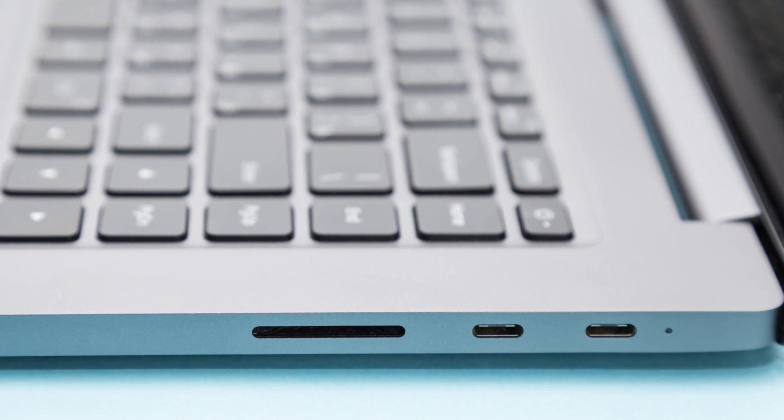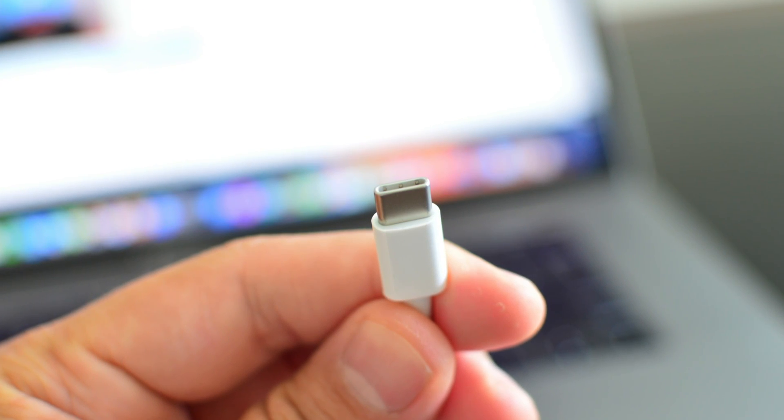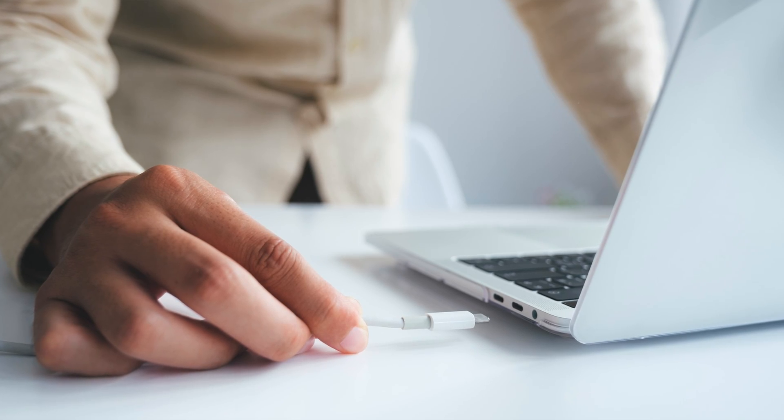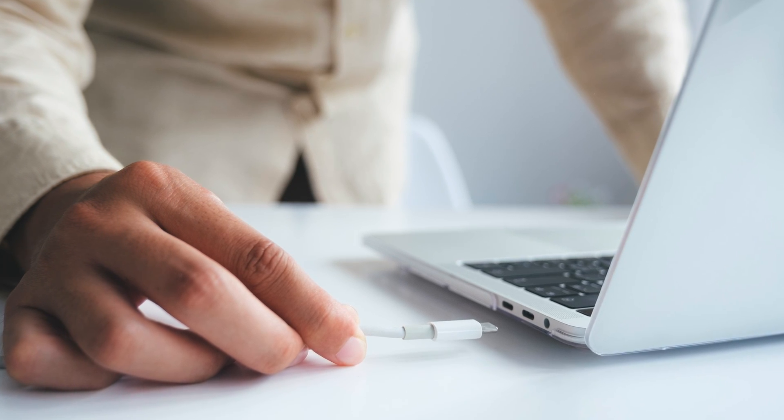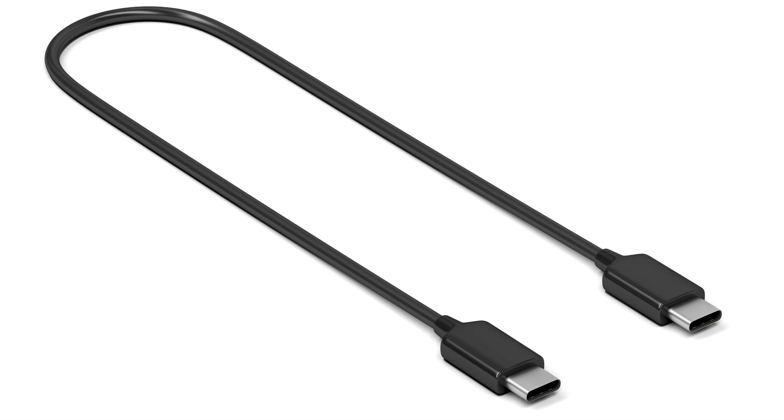Some modern-day laptops and monitors also come with a dedicated USB-C port. If your hardware configuration supports USB-C connectivity, you won't have to use an HDMI or DisplayPort cable. With a USB-C port on your laptop, you need to make sure that it supports DisplayPort over USB-C. You may need to contact the manufacturer of your laptop to check if the USB-C port is capable of this. If it does, then you can simply buy a Type-C to Type-C cable to transmit the audio-video signals between your laptop and your display. When buying a USB-C cable, make sure to avoid USB 2.0 Type-C; I would recommend at least a USB 3.2 Gen 2 Type-C cable. Also, some monitors and laptops support Thunderbolt, meaning you will need to buy a specific Thunderbolt cable. This will look identical to a normal Type-C cable, so make sure to check the specifications on the cable, otherwise you may lose some features with your Thunderbolt monitor or it may not work at all.